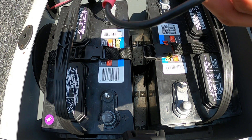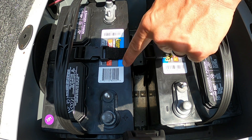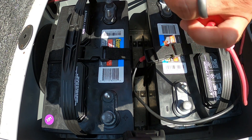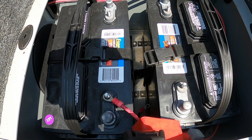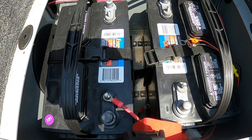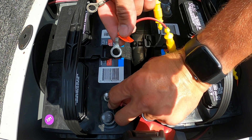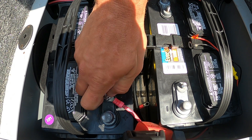These are our two wires from the receptacle. If you were putting a new receptacle in, all you'd do is run these two wires through your boat down to your battery box. On the positive cable running to the trolling motor, you want to make sure you have some kind of breaker on it — this is a 50-amp breaker, pretty common. This is going to go to the positive of battery one. Make sure you have your cover on here so nothing can arc against it. I'm going to put the positive that goes to the trolling motor plug up front on the battery post.